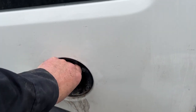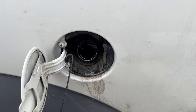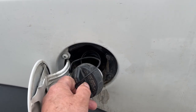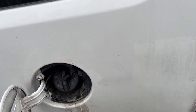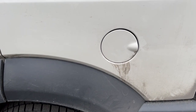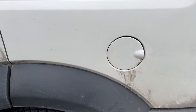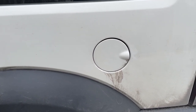On my initial inspection, I opened the fuel filler cap and inserted my camera in the fuel tank filler. Upon reaching the base of the fill neck where it attaches to the tank, I can see an amount of fuel that's collected and holding at the bottom of the fill pipe, just above the rollover valve or anti-siphon valve — that's in the top of the fuel tank.